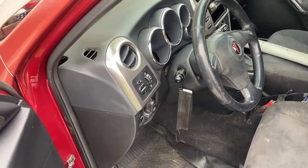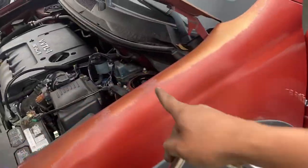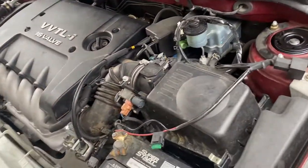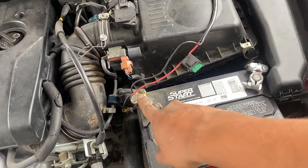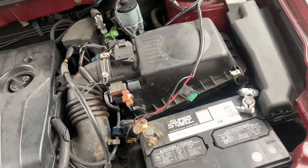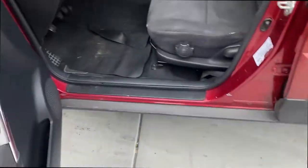So kind of figured it out. That switch goes over here to the relay, and then from the relay it goes in here, goes all the way over there, and it probably goes to that switch right there, or that wire right there. So what I'm gonna do is remove that power right there, this black one, it's on power, and put it over here. Hopefully it turns on, because you're gonna need power and ground. So connected it to the ground, and it looks like it's working now.